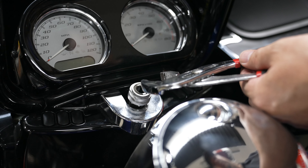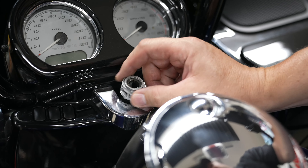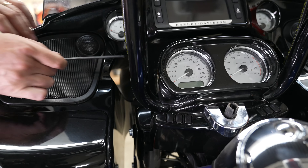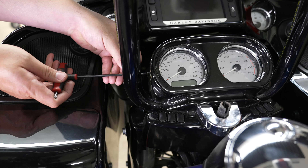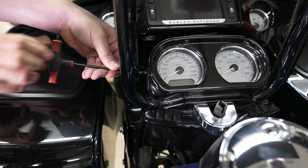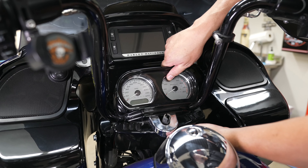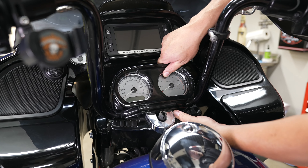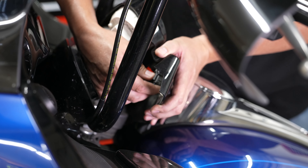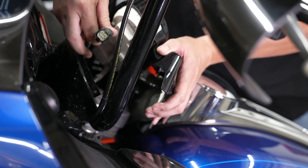He's going to take the spring off and then remove that top nut — channel locks is all you need — and then take the lower collar off. On each side of that inner dash panel there's a Torx T25 bolt on the left and right side. With those two screws removed, you can go ahead and pull this inner dash panel out. He'll have some plugs to contend with — just dead-headed plugs in caps. Push the tab and pull those out, or unplug whatever accessories you have.